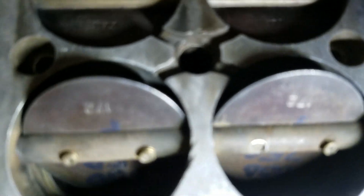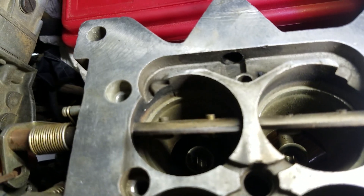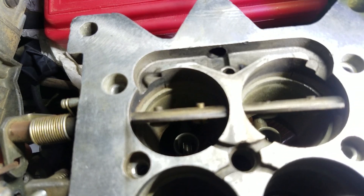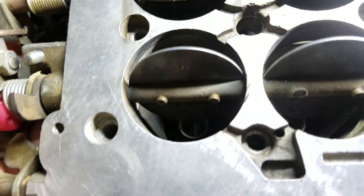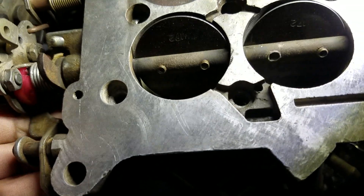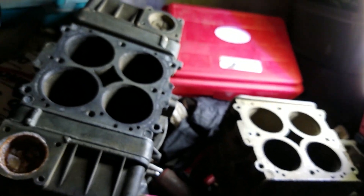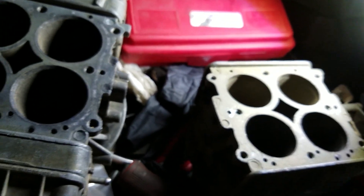Because the 600 main body doesn't have that taper, when you install a larger base plate you'll actually feel a little resistance when trying to open the throttle blades. If you look inside, you can see a small step on both the secondaries and the primaries, and that step has a lot to do with the CFM rating. The reason you can't just put a 650 base plate onto a 600 is because the throttle blades will actually impact the bores on the inside. To remedy this, you can use a step drill bit.